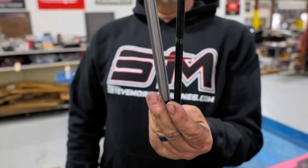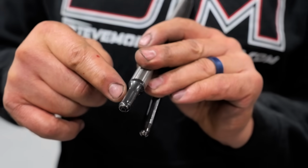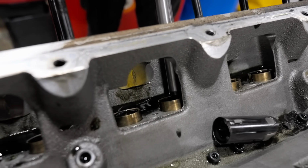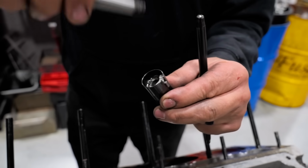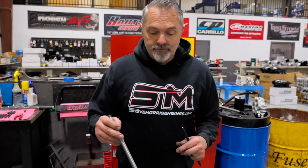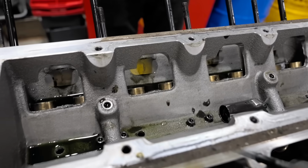I think that's a little bit different. There you go. You can definitely tell that overall size difference right there. Now this is a Manton push rod, obviously, and they have these really cool extended tips because you can't put this great big push rod in the lifter. Okay, so when this push rod, you see how far down this goes, especially with the offset. Is this an offset lifter? This is a centered up lifter. You could get away with it, but all keyway lifters have this step right here, and you just can't put a big tip down in the bottom. So it has to have this special hardened tip that allows it to have clearance on your sleeve and your push rod. So see how that goes over there? If that tip was not there, it would not allow any angle. It would not allow anything to happen. So that's why that's there.